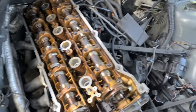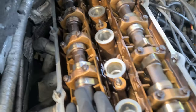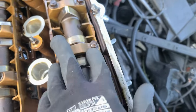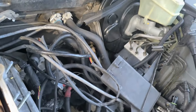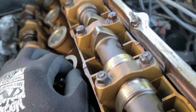Okay, so about the removal of these camshafts, what I found online, what many say, there are many ways of doing it. Obviously, again, I say there is a tool for this, but the basic fear is that because it's so brittle, it can crack or just snap when you untighten this, and these are extremely tight. So what I was recommended is to, so you see, you got one cylinder, two cylinder, three cylinder, and you can see these rockers, they're facing up. So those that are facing up, they do not obviously apply any pressure to the spring load under, right?